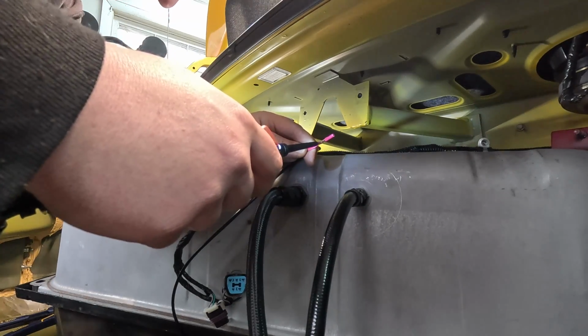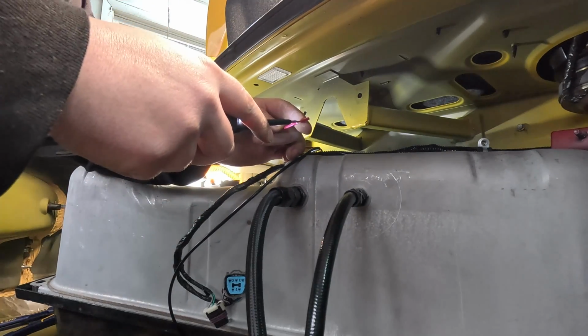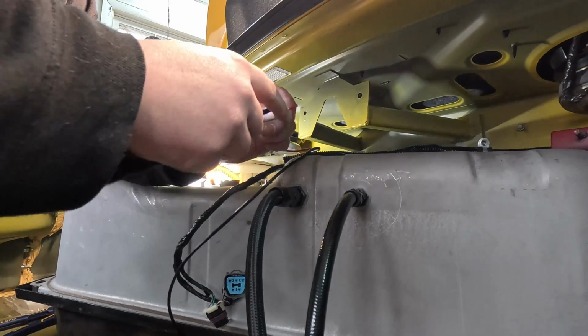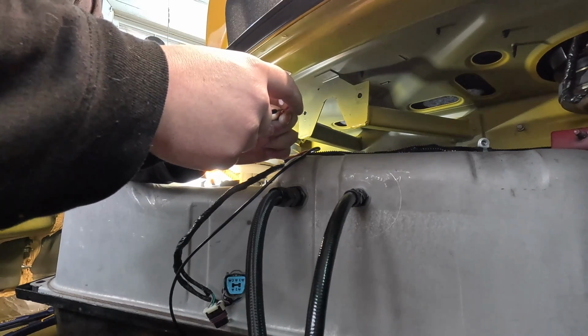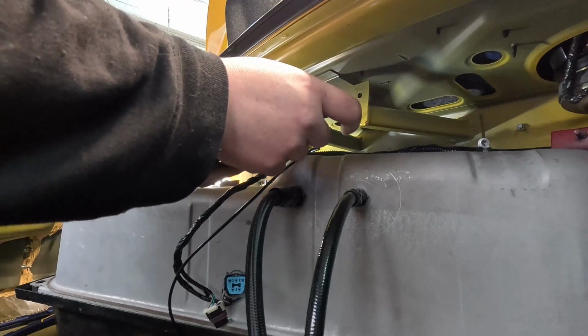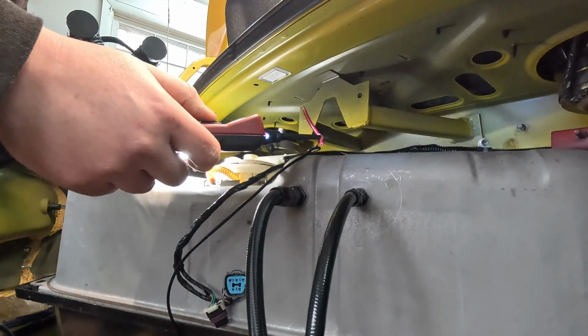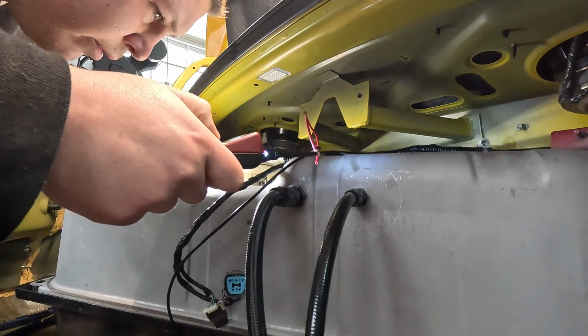Stop. And then it drops, right? Yeah. Alright, so we're powering our 525, guys. We had 60 psi fuel pressure up front, but then it drops as soon as we stop the power. Let's try it again.